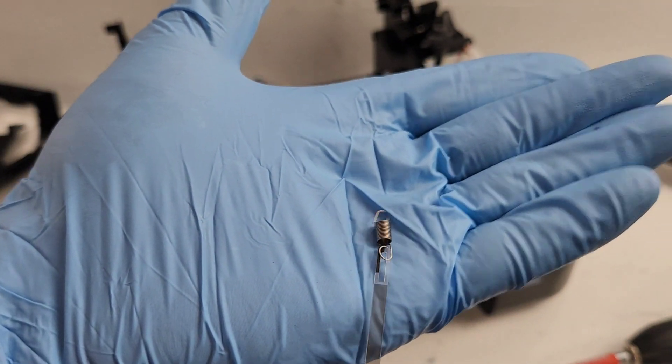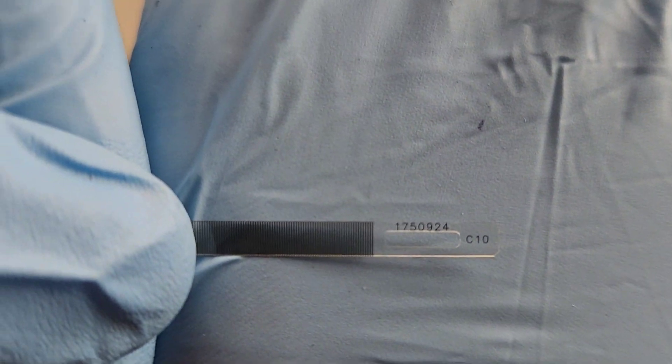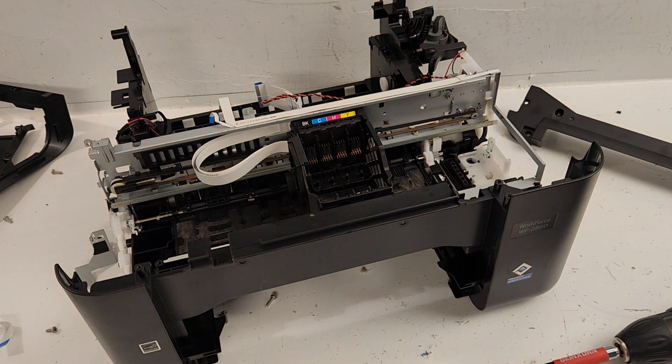Put this spring in a hook - this one just attaches to the hook on the printer. The part number is actually on here; it's very tiny, but most Epsons or HP printers will have a part number on there. The part number would be 1175092-4 for the encoder strip. Let's go ahead and remove the print head - that's going to be the last part we remove.